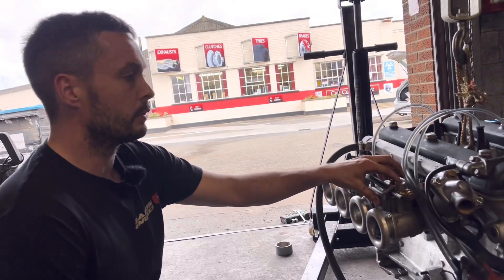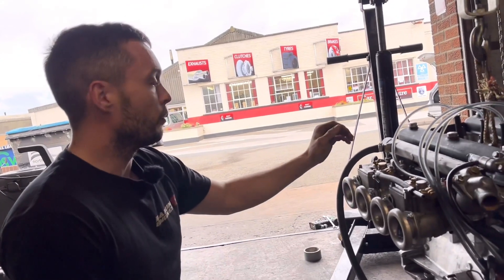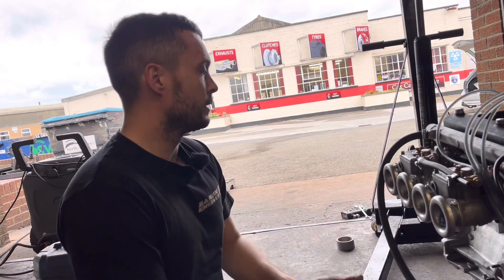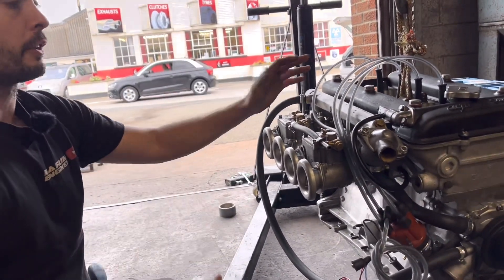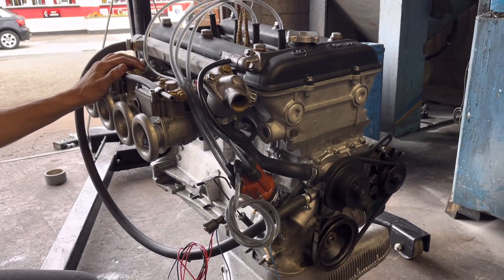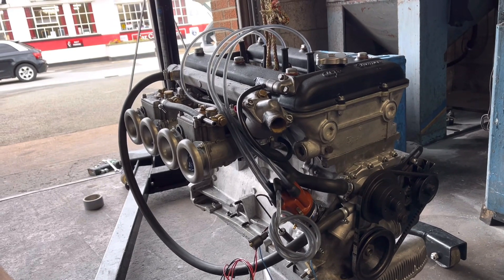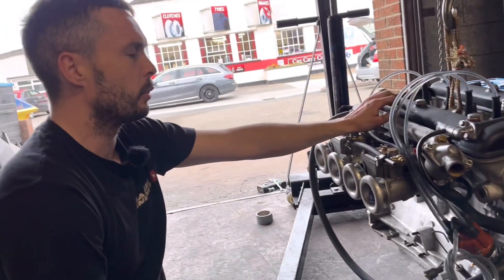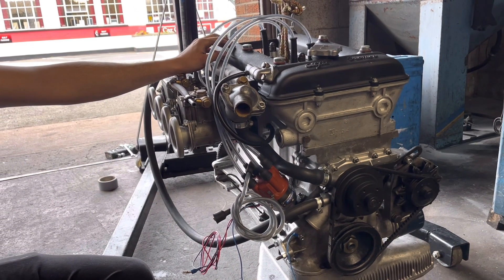What was happening was you could hold the engine at 6,000 revs on the dyno for 5-10 seconds and then it would start to lean out and misfire — you can see it on the AFR. So we've changed those and gone down on the jet side, because what people were doing was putting bigger jets in to compensate. We've gone to 130 jets and then 150s, and the idles have gone to F9 just to sort of bring a nicer crossover to the main idle jets on a fast road engine. We're on 40 DCOEs with 32 chokes. The head's been ported — it's a nice head. The valve guides have been shortened for extra lift for the cams. They're fast road cams, about 11.8mm lift on the cam, but duration's not so big.